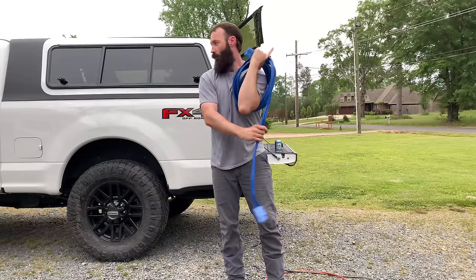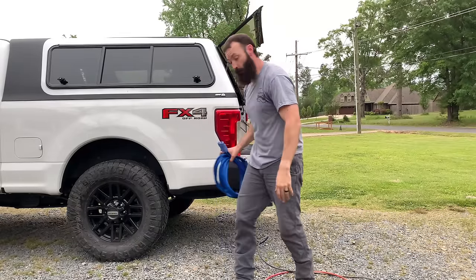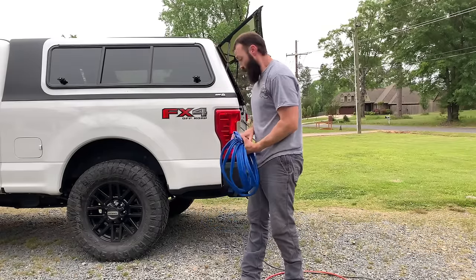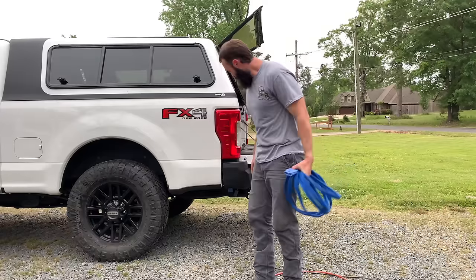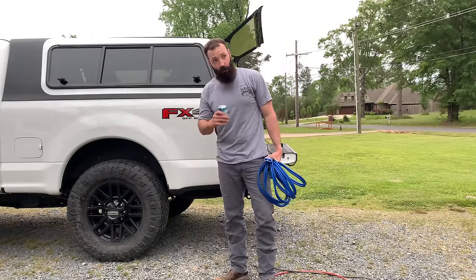Positive running over here to the terminal that said BAT, and then this other cable running all the way to the back. Right now the breaker is open — I click that and it closes it, and now it's hot all the way to the back. Push that and I can ride around until I need it — I just come in here and flip this little lever up, boom. That's all I can do before the rain, but tomorrow I'm going to take you on a little excursion. I got a whole bunch of activities I can now do because I have power.